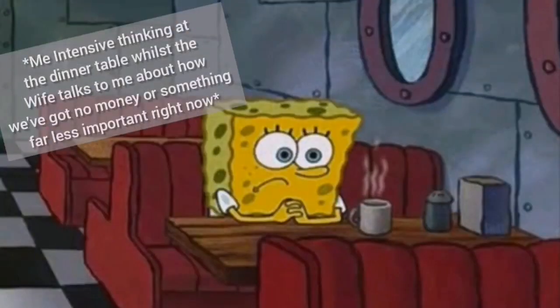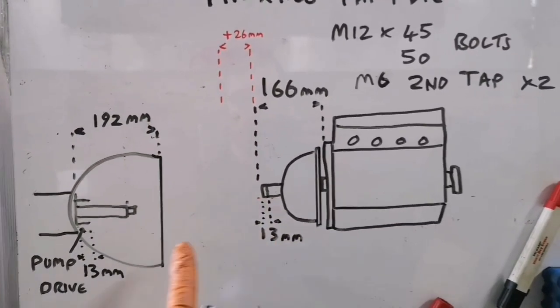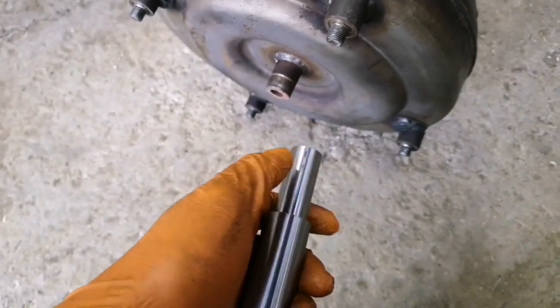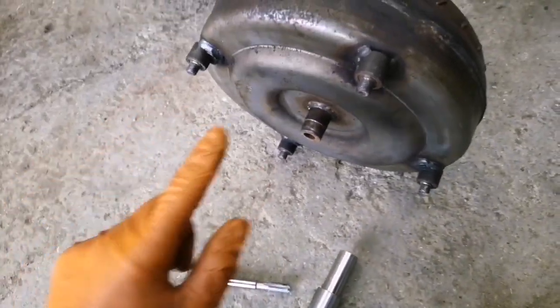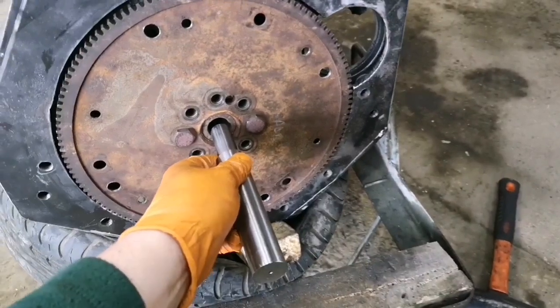So I'm going to have to come up with some plans. I need to extend this 26mm to get it all to sit in its original position. A piece of steel — this will thread on that. These will be 26mm long. I'm actually going to drill them all the way through and then thread them entirely. Then I'll send bolts in to hold the flex plate and torque converter together. And for the snout of this, just a little adapter which will pick up on the centre of that.